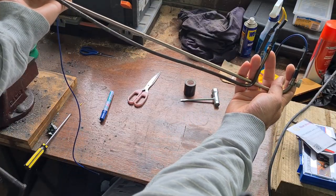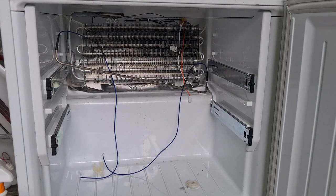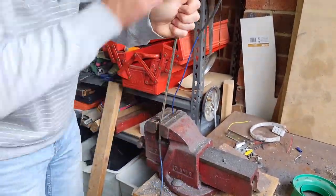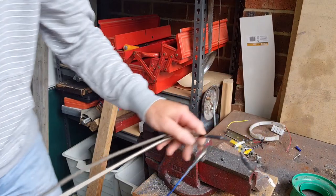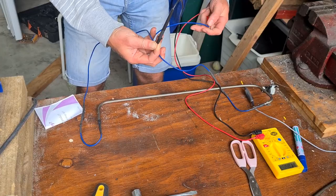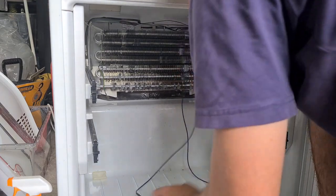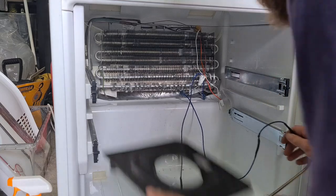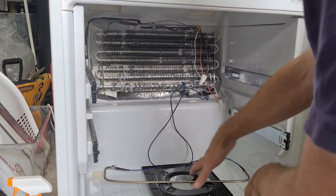That's not even close to the original size. That is much closer to the original size. What I'll do though is make sure there's still some kind of continuity through it and I haven't snapped something internally. To see if it works, I'm just going to plug it in and run the fridge for the required three days and see if it makes a difference. Rather than spending time assembling it, if it might need to be reassembled again, I'm just going to sit it on here so that it doesn't melt any plastic.